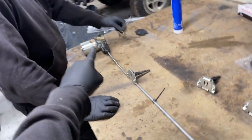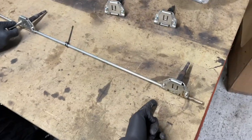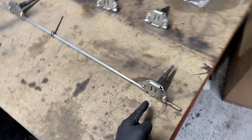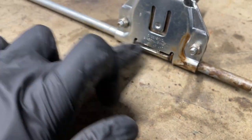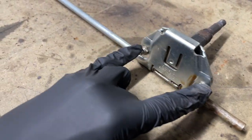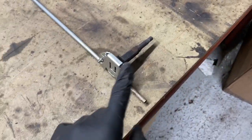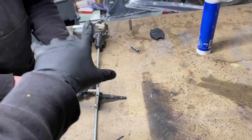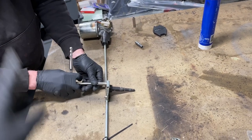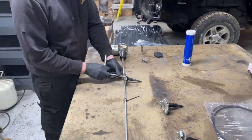Motor assembly, the wiper tubes, and obviously our two spindles. Now this is the driver side, which we believe to be at fault. We can already see like a mucky buildup here of all the old grease. So basically what we're gonna do is slacken off these two 8mm on both of them. That will be able to, you know, separate the worm gear from the cable, and we can have a good look at this assembly. And then we're also gonna basically take off the cover to actually get the cable free, replace the cable, grease it all up, start again with some new spindles, put it back together, and we should have a fully functioning wiper system.